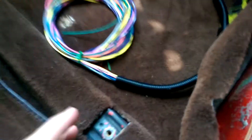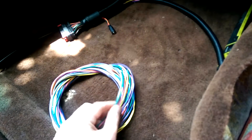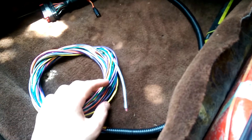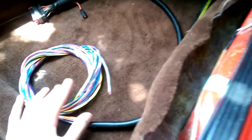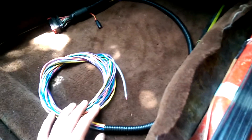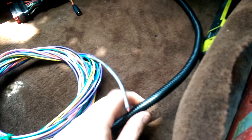These are all the wires that are either just not being used or they're not going into the engine bay. For example, the enrichment and warm-up LEDs and the bootloader connector — stuff that's going to just be in here — like the fuel pump ground, because that's going to go right to the relay inside here. I really like this conduit, you can get it at Napa or wherever, it's pretty cheap and it really cleans it up. I'm going to be doing that throughout the engine bay too.